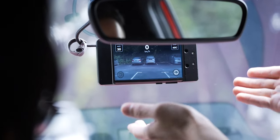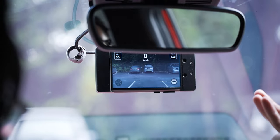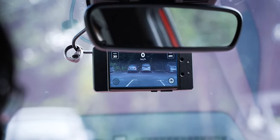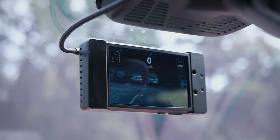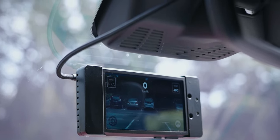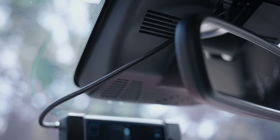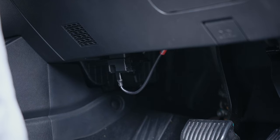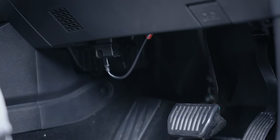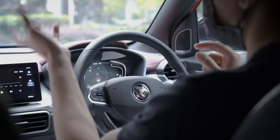This is definitely the main device here, which is the brain and the eyes of the system. And how we interface with the ADAS and also the ACC and also the LKA signals is actually through the relay. We call it the relay. The relay is placed inside, and then it is connected. We unplug the original connectors and then we loop in our hardware by plugging into the specific connectors for each model. The system is engaged now.